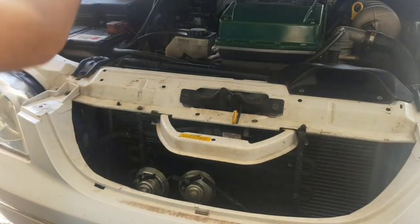Don't forget there is that little plastic retaining clip over here as well — make sure the cable won't go flying around and chafing on anything. With the cable routed all the way through to the top of the guard, we can do a test. I was initially making sure it was visually looking like it was latching well, then I pushed the bonnet down — and on the very first attempt it just popped straight up with no issues and no hesitation. Job success!